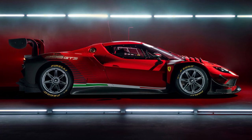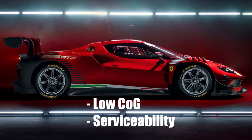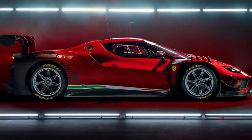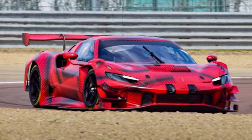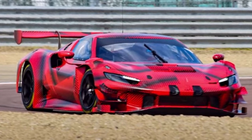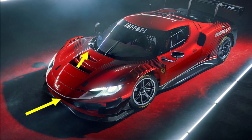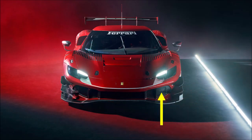With the experience of their last GT3 cars, Ferrari focused on optimizing the center of gravity and serviceability. A low COG helps to get a better balance if you need to add ballast under BOP conditions, and the car is very much simplified so it's easier to repair during races. Part of this is also that the GT3 car features a large water radiator in the middle — the main inlet can catch the highest pressure and there is a huge area to exit. The sides are closed and Ferrari uses large canards to produce downforce and vortices along the sides to support wheel arch extraction.